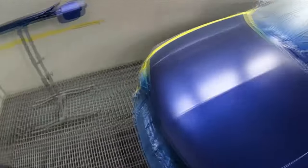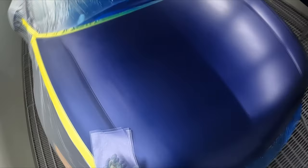So yeah, let's get this job done, baby. This is the second part on the paintwork on this Honda Accord. Pretty big job, all the way down that side, but the two doors are actually second hand doors, so I've got to paint inside and out. I'm just giving the blends a bit of a tack rag, because all of that overspray turns a bit dusty on your blends.